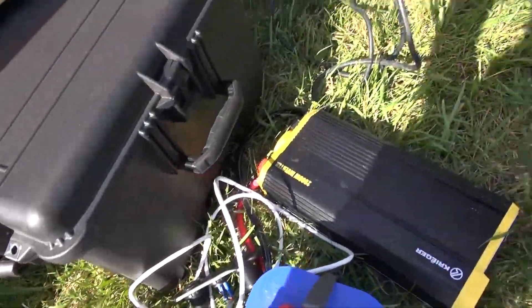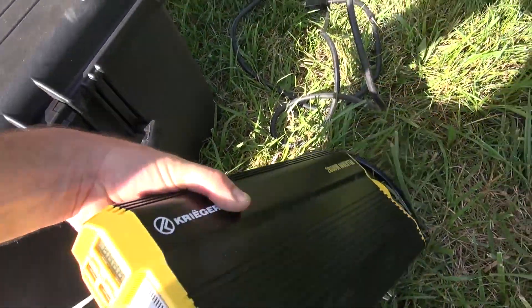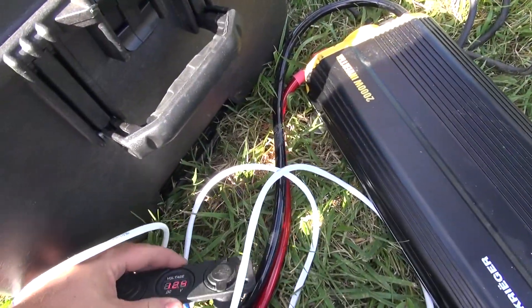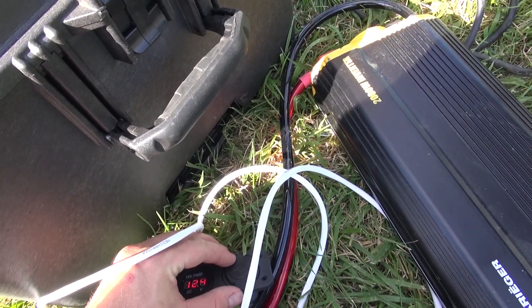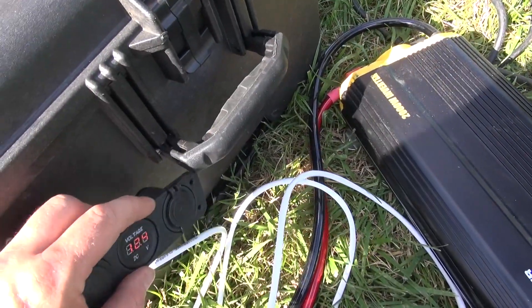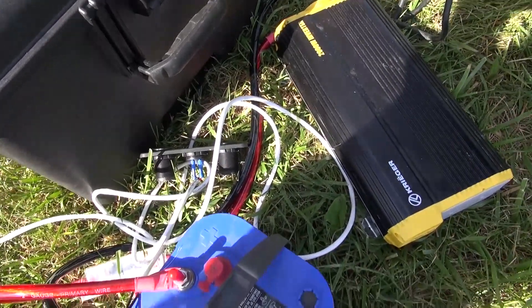From the battery I have wired in our 2000 watt inverter, which I think is going to be able to run the tools that I've brought out to test with. I also have a voltmeter right here which looks like right now we're at 12.4 volts. This will be one of the items that I will be flush mounting into my box later, along with the outlets and switches to be able to use the inverter.